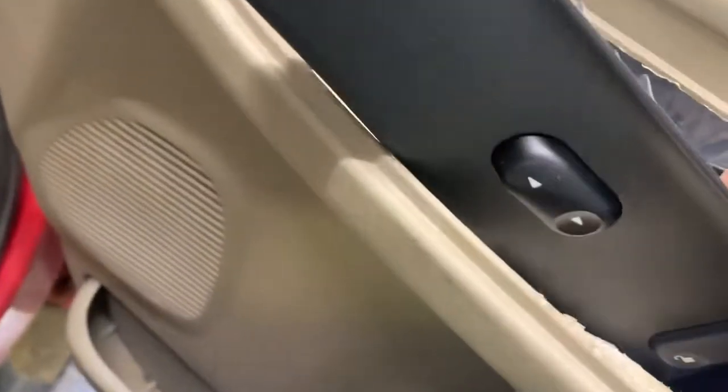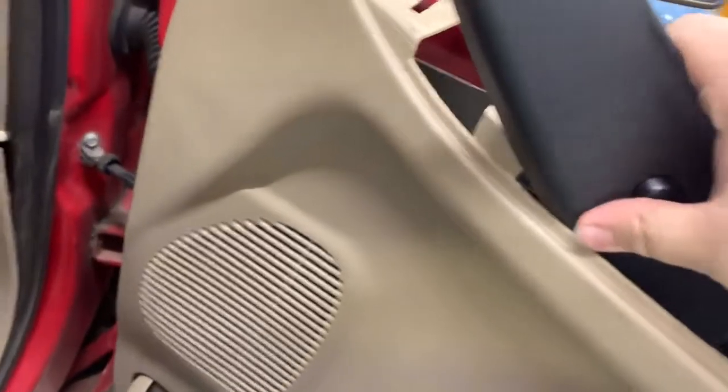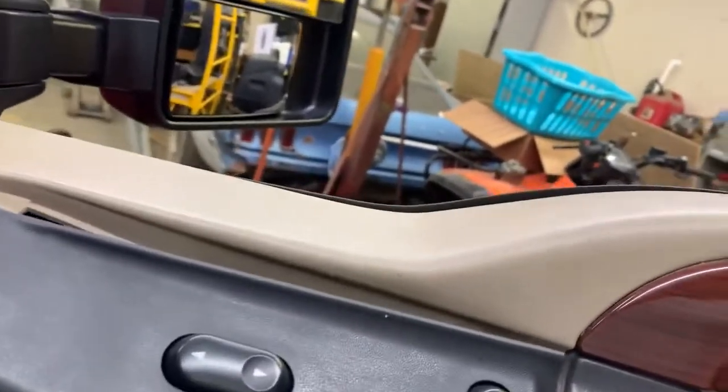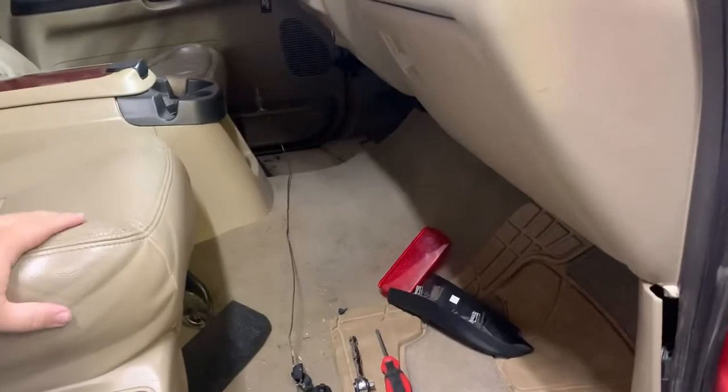Okay, so now I got the new mirror on, got the old one over here. We can go ahead and put our door panel back on. Now, with your switch panel, you can come up through just like so. Got to kind of work with it. Again, especially being one-handed. So you can work it up through just like so, and it's good to go. Now you can lock your door. Set this up here, pick it up a little bit, over, and back down. But up and over here, and then you can unlock this. But I quit filming to make sure that we were seated all the way through here on both sides, and we are. So the door panel's in place. Now we can go ahead, put our 2 screws back in, and we will be good to go.